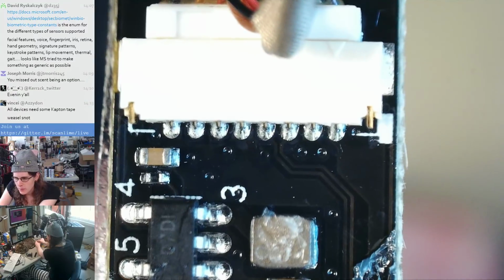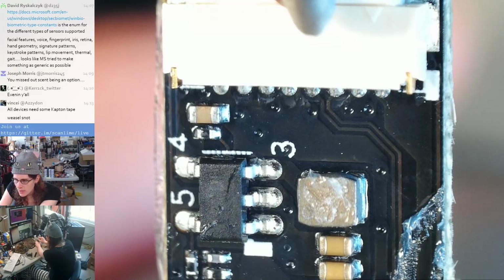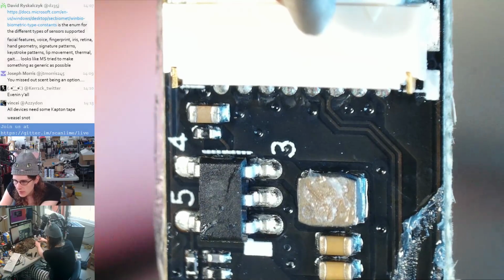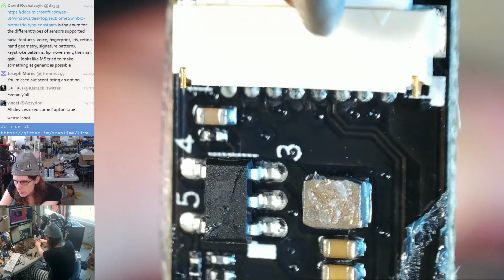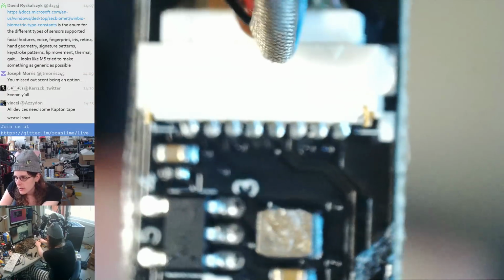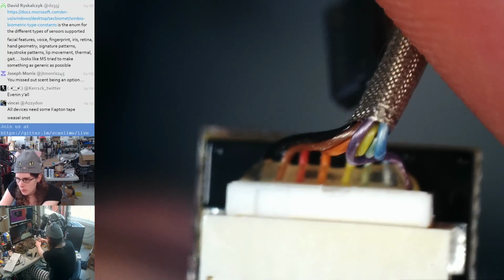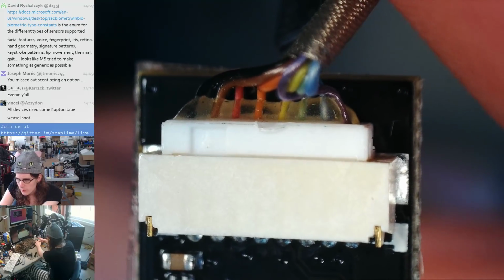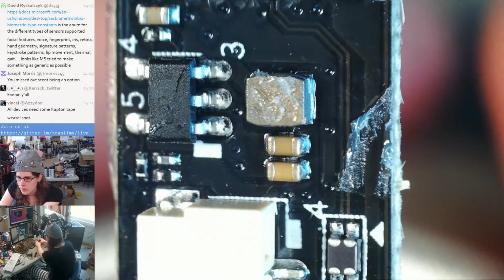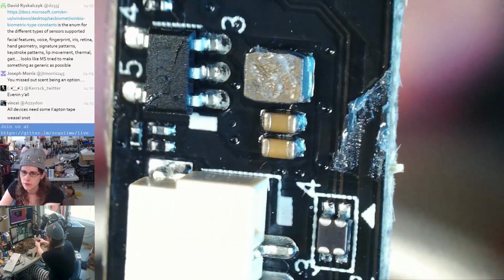So we definitely can see the USB pairs just going straight to, what is pin 1? I assume that's pin 1 on the right. So we'd have ground, we have ground, then I don't know what the next one is. It's going to some vias, might be a power fill. Then we have USB, and then 4 more pins, like that one on the left seems to be going to that polygon, which might indicate it's a different voltage. So I'm guessing we're going to have 5 volts, 3.3 volts, and maybe a couple of no connects. But I don't know why they would have fully populated the wiring harness here if it was no connects. There could also be some other stuff like an enable, or I doubt you'd see a second voltage, because if this is a switching converter, then you'd see a second inductor.